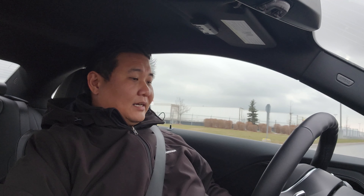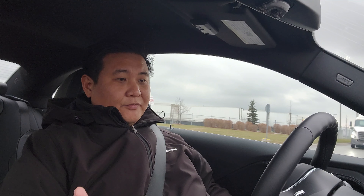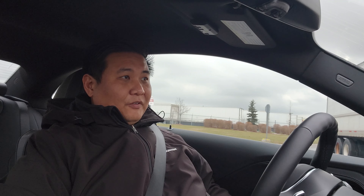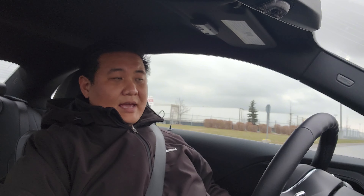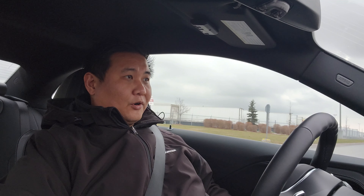I'm standing on the gas pedal with my right foot. I've got it on the adaptive content view through the live vehicle menu, which gives me boost, horsepower, torque, and oil temp. With the B58 TU in this vehicle, it's going to hold at about 11 psi — that's when you want to take your foot off the brake to maximize your launch.